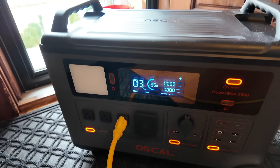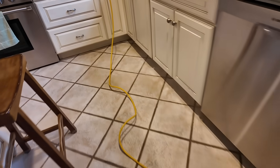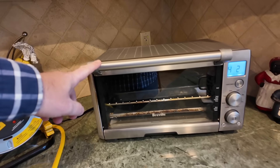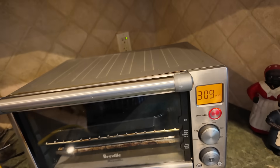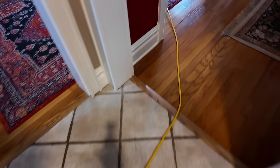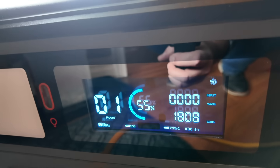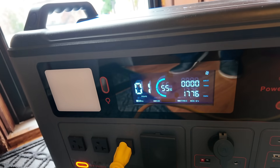I've got the reel plugged in — power station is on, AC outlet is on. Despite what a lot of people think, a refrigerator does not take a lot of power — just a few hundred watts, and even less when the compressor turns off. The defrost cycle is your highest usage, so a fridge isn't a great test. A toaster oven, however, takes a lot more power. I've plugged the toaster into the reel. Let's put it on a toast cycle and walk over to the power station to see what we're pulling. I heard the fan spin up from across the room — and we are pulling 1,800 watts from the power station. The fan has spun up as expected to keep the batteries cool. That is an absolute win.